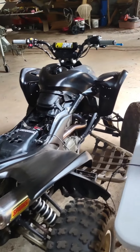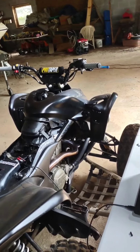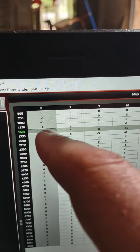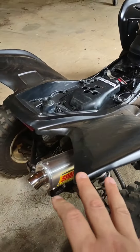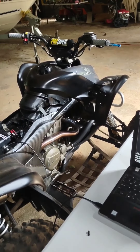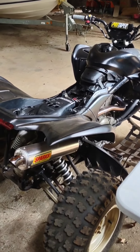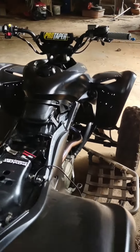At 900 feet of elevation here, that makes a difference. So I went ahead and adjusted the trims at zero percent throttle — everything at idle — going from negative 20 to negative 8, and that's where the bike liked it most. The idle cleaned up, got smoother, and the pipe went from glowing red to just a regular hot color. I accelerated, drove the bike a bit, and it's way better — it doesn't cut off and idles much better.